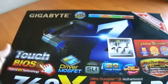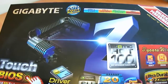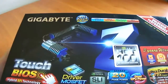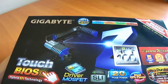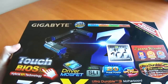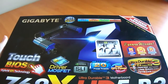There's an icon that says 2011 expert motherboard: ultra cool, ultra durable, ultra efficient power, ultra performance, and unlocked performance with Intel K-designated CPUs. So if you have an Intel Core i5 2500, you will not be able to overclock past turbo mode unless you have a K-series processor, which does carry a bit of an extra price tag. Like all Gigabyte motherboards, this has ultra durable 3 with 2 ounces of copper — twice the amount of copper in the printed circuit board.